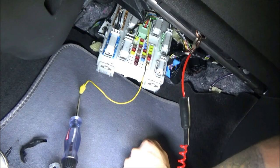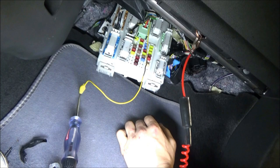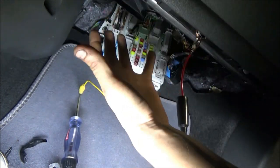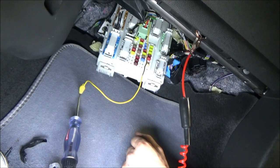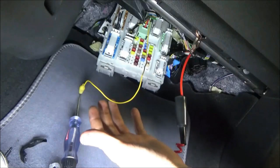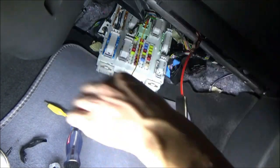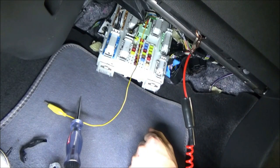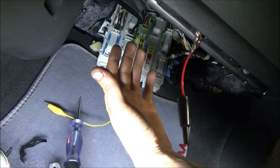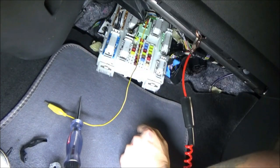Based on the fact that our fuses are good, we're not worried about the ground side fuse because I can provide power on this pin and the doors are locking. And regardless, that wouldn't matter anyways because the grounded fuse on this particular relay, the lock relay, the only time that would matter would be unlocking the other doors. So that provides the ground for all of the latches when the switch is pressed into the unlock position. So it's definitely looking like a bad body computer.